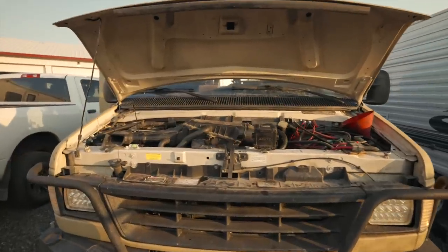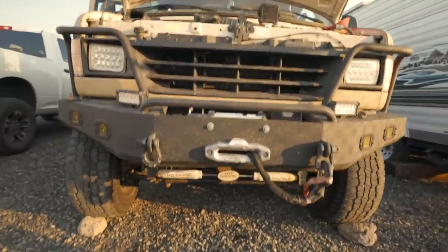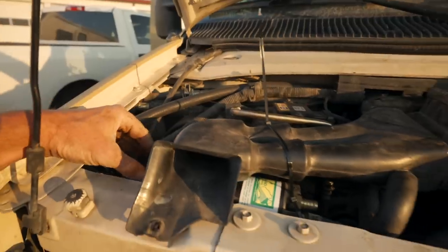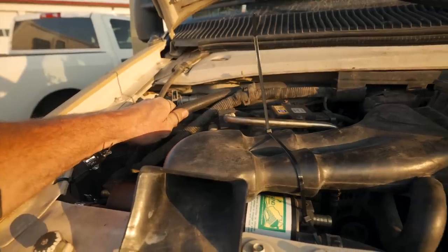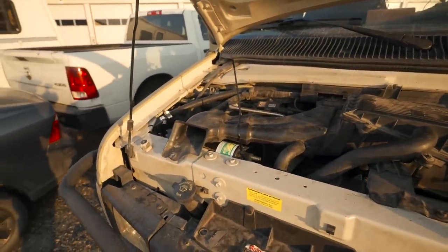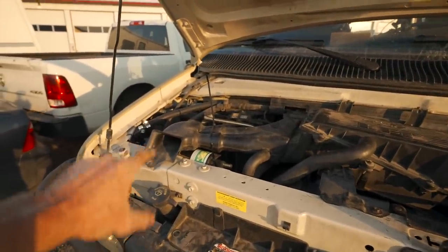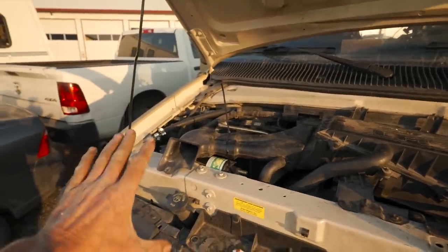Good test of the van — I've had it running now for a little over an hour. I don't see any leaks down below, so that's all good. I've also checked the hoses I added — the new ones going into the heat exchanger are nice and warm and I don't feel any more air bubbles going through them. The heat exchanger itself is also very hot, so that's also good. Next step is to get the van over to Dirt Road Garage to have them build a bracket, because right now I just have it tie-wrapped in place.